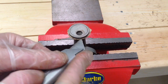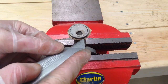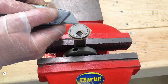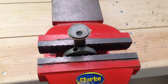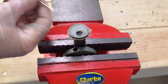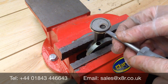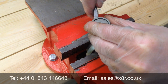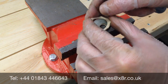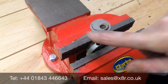We've managed to cut away most of the old seal. Cut into the seal just between the clamp ring and the piston, in the gap which the seal sits in, to make a small hole — do that at the front and also at the rear, to allow us to get a screwdriver in there to start levering the clamp ring off. We can now lever this off, starting with a small screwdriver and incrementing in size, lifting away the clamp ring. Slowly in increments, lift the ring off from the front and the rear until it raises up and can be removed. We can then take off the remnants of the seal and clean around the piston groove, removing any remnants of the old seal or any dust it may have produced.